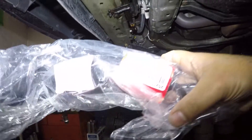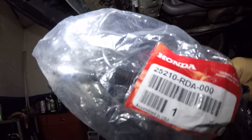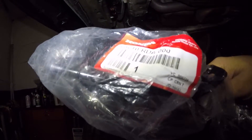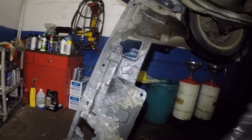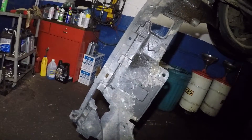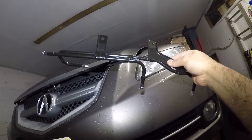So I went and bought one of these. Here it is — this is the pipe. The part number on this, I got it from a Honda dealer. The part number is 25210RDA000. Inside this bag — let me take it out of the bag. Alright, so this is the pipe you're looking at on this Acura TL. Transmission pipe is leaking. This is the pipe. It's down below guys. If you need to change this, you need the part number — I got it right here.